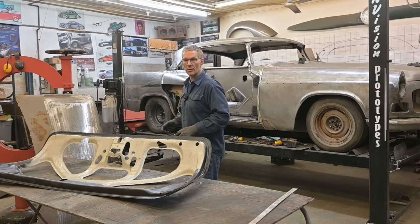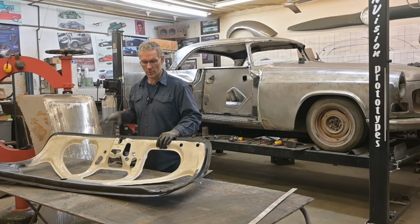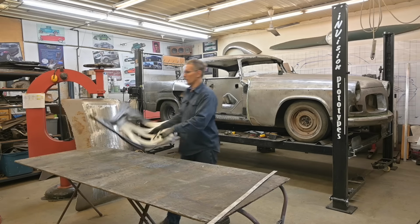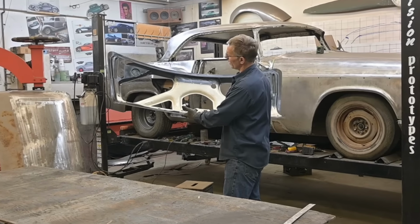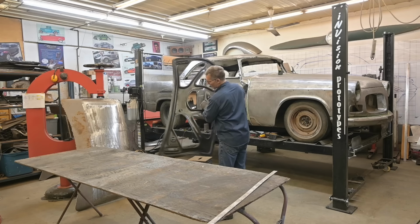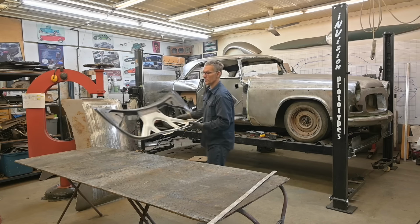You're watching Envision Prototypes. I'm Nick, if you're new to our channel, and what we have here in front of us is the trunk structure out of that car, shortened 10 3/4 inches. Not sure if you guys can tell, but I think that looks almost factory. Passable, yes. So I went ahead, media blasted the inside and outside flange, and gave it a coat of epoxy primer.